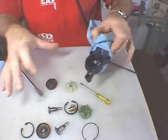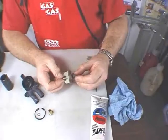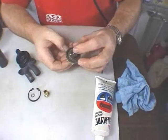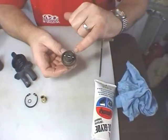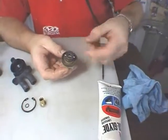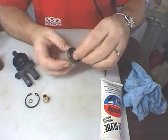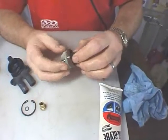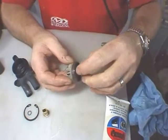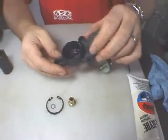We'll clean all the components before we attempt to reassemble it. I have my shaft and my new seal. Note that the seal goes this way — the other side of the seal is completely brown. The recessed area will be visible on this end of the shaft. I've reinstalled the impeller, lubricated the seal and the area around the outside of the seal with silicone grease, and also cleaned and lubricated the interior of the housing.